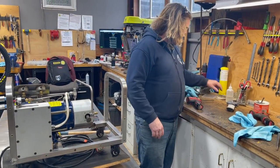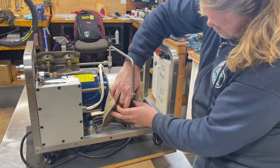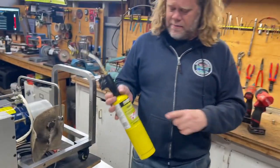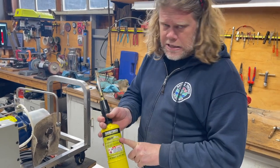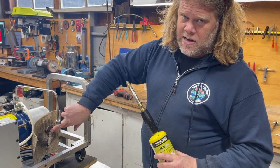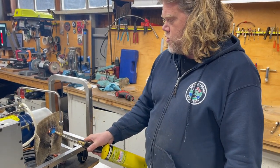What we're going to need now is our flame-resistant cloth — these can be purchased at a plumbing supply store. We're going to put this over the machine, then take our MAP gas torch. This is MAP gas, not propane — MAP gas is really really hot, twice as hot as propane, and does the job much faster. We need to get this screw heated up to about 400 degrees Fahrenheit so that the special thread-locking compound will break free and we don't strip the screw.